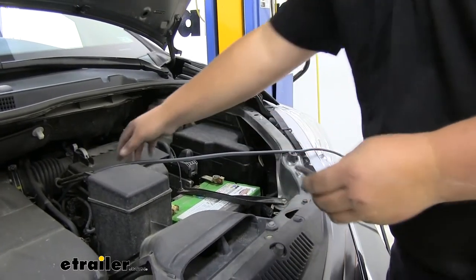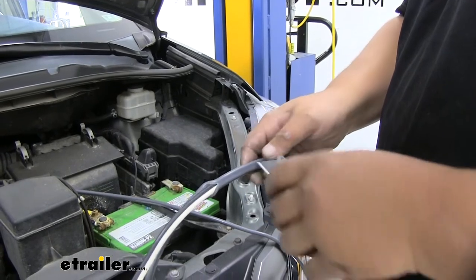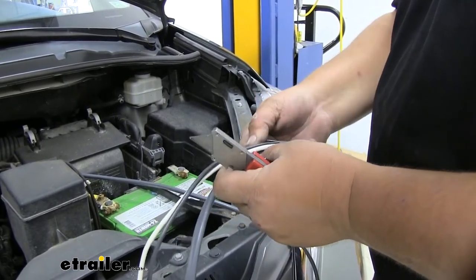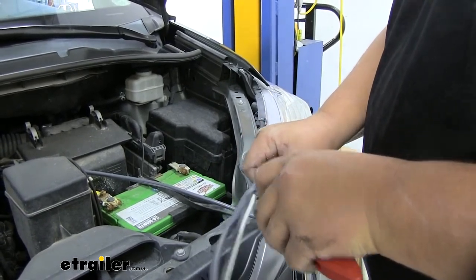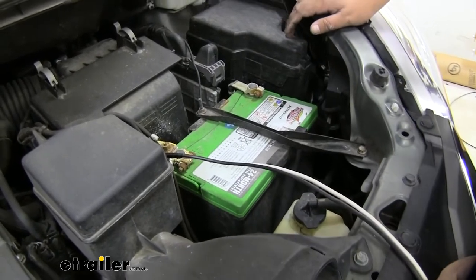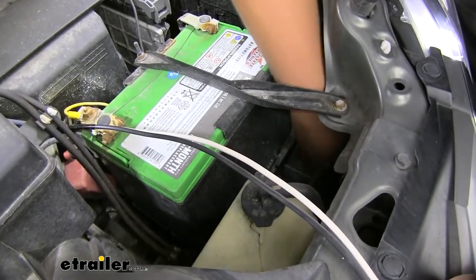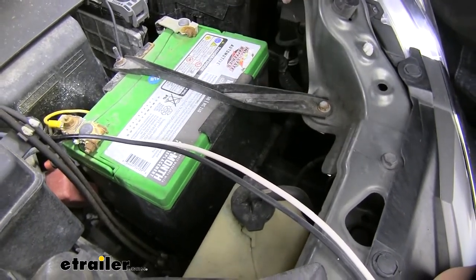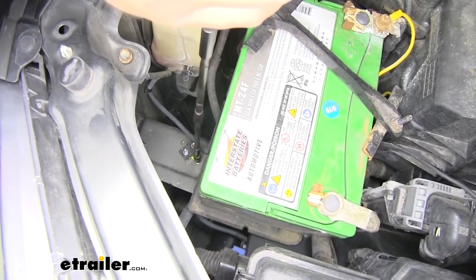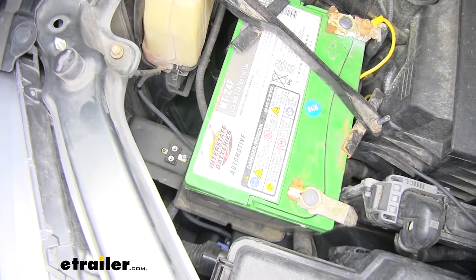It's a good idea once you get all this wiring pulled up to go back underneath the car and make sure it's not hung up on anything. We want to go ahead and cut this sheathing back all the way to right about here, then get that black wire out to make our connection to the battery. When we're splitting this sheathing there is going to be a noticeable gap between our wires — we just want to take a knife, kind of push down in here softly, and then pull the blade out. Make sure not to cut the wires on the inside. We now have our wires ran up here — I zip tied it right there just to secure it down. We do have to add a 40 amp circuit breaker and we want that as close to the battery as possible. When you look down here there's a nice cross brace that we can mount that circuit breaker to. We're actually going to need to add another circuit breaker just for our brake controller, but I do suggest taking off this battery support just to give us a little bit more room to work. As you can see we have our circuit breaker mounted right there — now we can grab our self-tapper provided and mount our circuit breaker permanently.